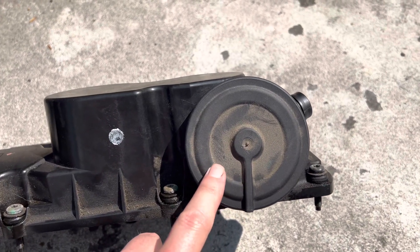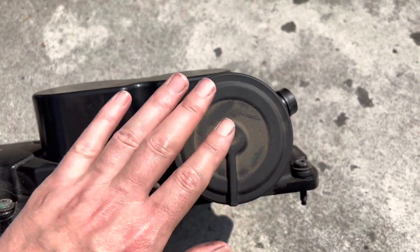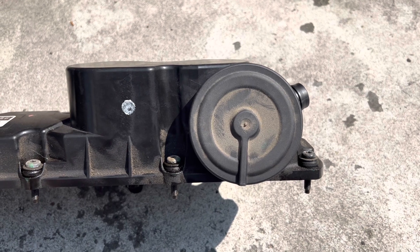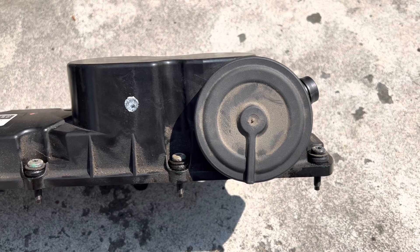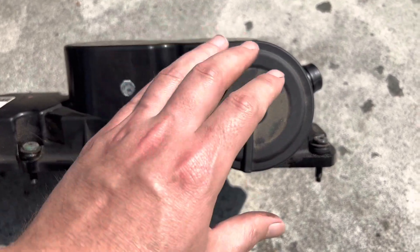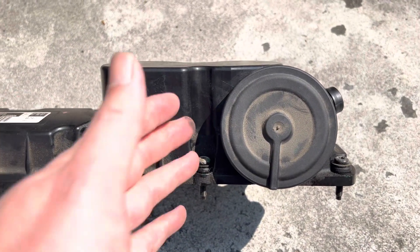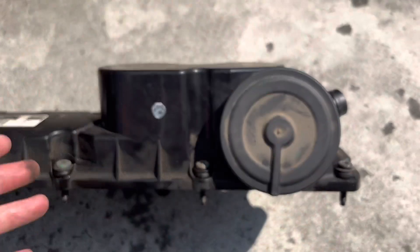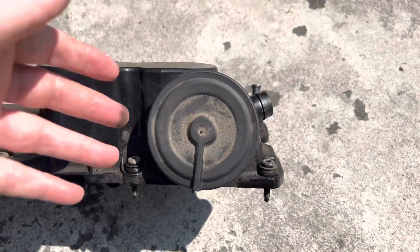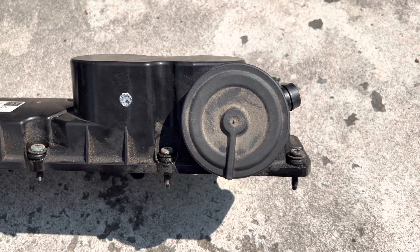This valve cycles between open and shut. There's a rubber-type membrane — it's just flat. The idea is you want it to be closed when it can, because if it were open all the time — just an open channel for vapors to go to the intake — you'd end up sending a lot of oil vapor that doesn't get caught and separated. You'd have a whole lot of oil vapors getting fed into your intake manifold, so you'd have oily intake air, which isn't good.